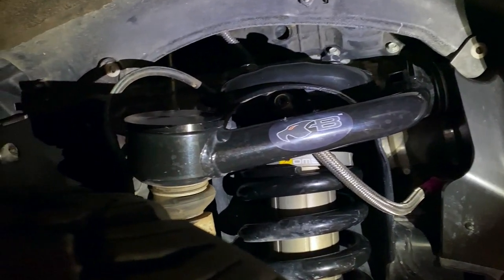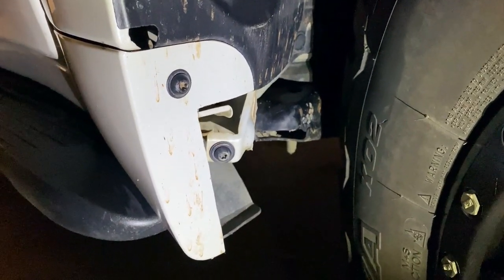When fitting tires this big — 33 inches or above — there are some additional components you'll need, mainly relating to the suspension. On my vehicle I'm running a two-inch lift — an ARB lift with BP51 remote reservoir shocks. In addition to that I've had to fit aftermarket upper control arms, which bring the caster angle on the front back from zero to the factory three degrees it was designed at, bringing the front axle forward just a little. You may also notice there are no mud flaps on the front wheel arch — they don't fit, so I had to do some trimming of the factory plastic and push back a small metal bracket that the mud flaps bolted onto. I've also had to fit a rear adjustable panhard rod, which pushes the rear axle back into the centre of the car. When you put a lift kit on these cars the rear axle shifts, and with positive 25mm offset wheels pushed right out to the guards it becomes quite obvious. The adjustable panhard rod brings it back to centre and makes it look factory.